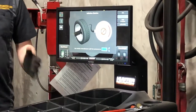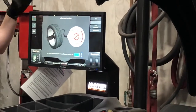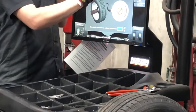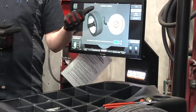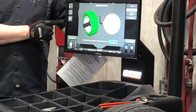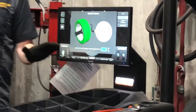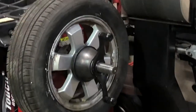I also want to note while doing this — it still works even with gloves on. Unlike a cell phone, this isn't a touch screen. There's a gap between the frame and the glass with infrared beams that run across it. When you touch something — a pen, your finger, or a wheel weight — you're breaking the beam. So if something's not working, the answer is not to push harder on the screen, because that'll just break it. It means the beams aren't reading, probably because it's dirty down there. So it set the pressure for me, and now I'm ready to go back to the car.